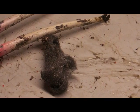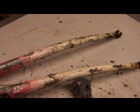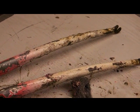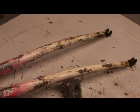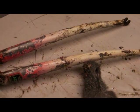So what we need to do now is a good scrub with medium-coarse wire wool, which will scratch the surface of the paint and allow the Nitromors to penetrate underneath the paint and lift it off. We'll give it a good scrub down with the wire wool, leave it five or ten minutes, and it should lift the majority of the paint off.